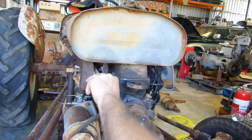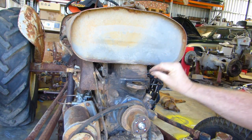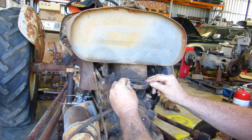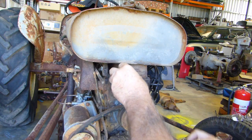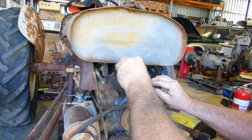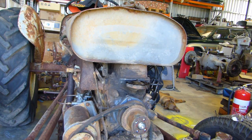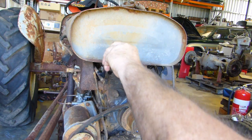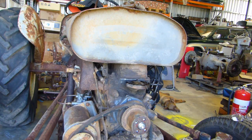I've sanded this rod down and cleaned the gasket off the main surface area here. We're going to need to put a gasket down here. In this instance we'll just use a little of our black goo — our Loctite Aviation Cement — just to run around there. No silicone. And on this rod here where it comes through, we're going to put a little bit of Never Seize, so where the throttle rod comes through the aluminium housing we should be okay.